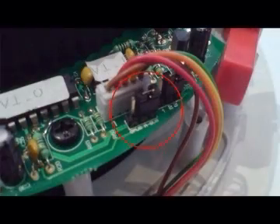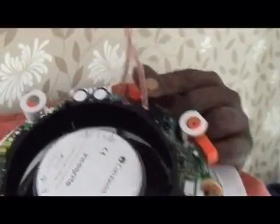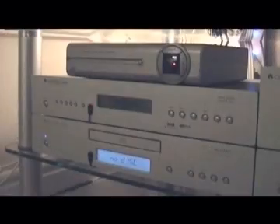AS10 Active Speakers: Strip the CAT5 cable. Terminate the left speaker output — the cable then goes to the second speaker. The jumper needs to be on the right input. Terminate in the same way as the SS10. The IR10 plugs into the appropriate source output on the AH10 — CD, DVD, AV1, etc. — and the self-adhesive emitter is attached to the IR receiver on each piece of source equipment.